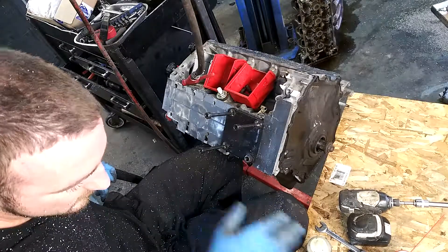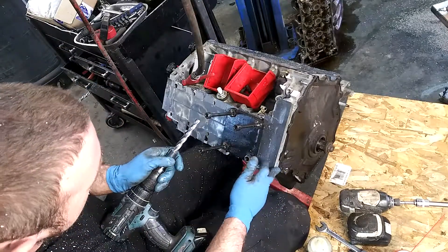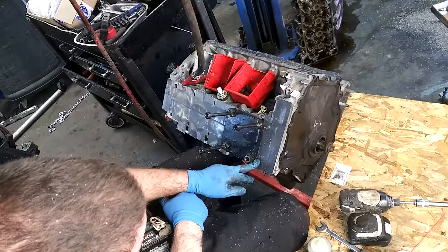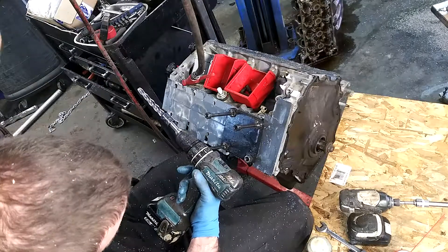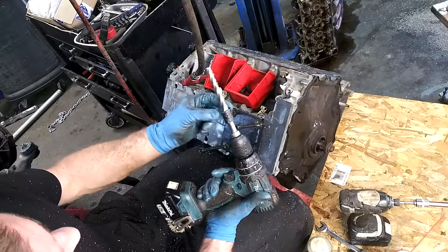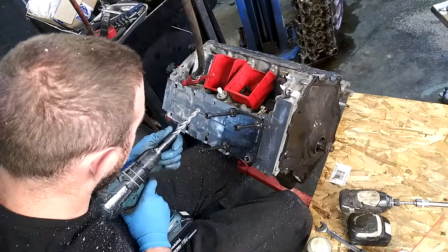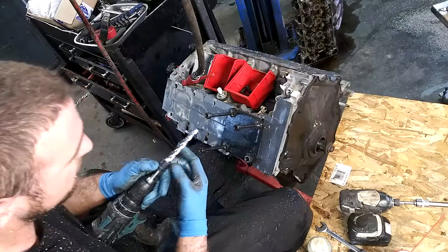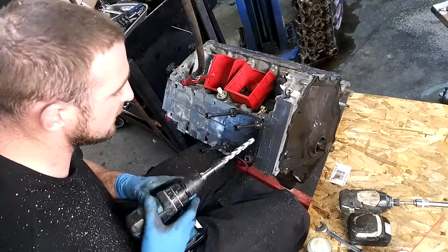Now we have that reamed out. I want to make a note here: because this is a first generation Northstar, the bolts are the same height — that's the shorter height top to bottom. In the second generation Northstar, the bottom bolts are longer, I think about 15 millimeters. The kit comes with a bushing spacer so that you can preset the depth with this ring collar. If this were a second generation Northstar, we'd drill it out a bit deeper and remove this bushing for the lower section. Because this is a first generation, we're using the bushing top and bottom.